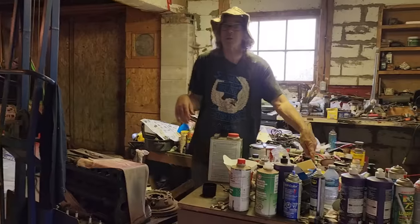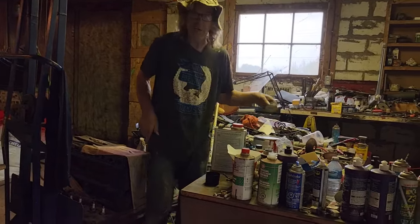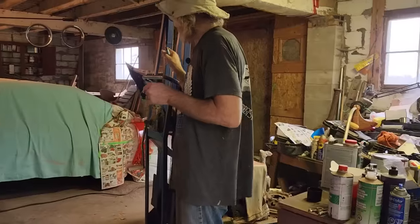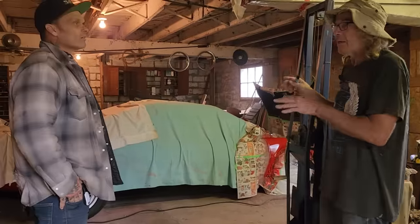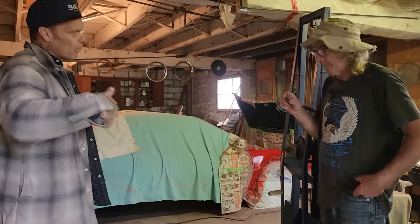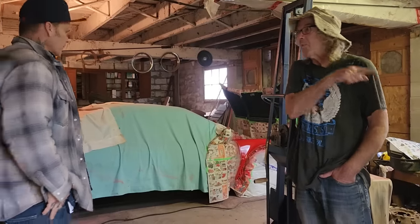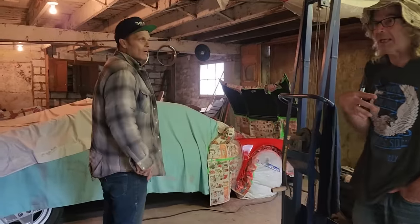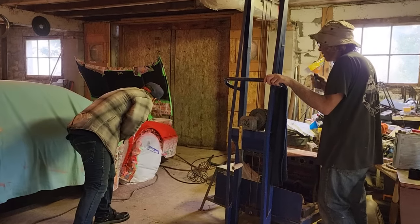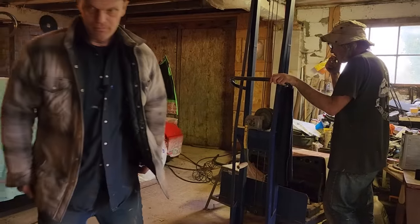That little screen was covered with oil when I put that top on, so that could have been our reason. So if it can probably handle a little bit of that, I would go a dry coat over it all, let it set, and then try to go a little more as you get going. Especially if I've eliminated the problem now with the new paint coming on, because if I was getting fish eyes consistently on more sprays, no matter what we do, we're not going to fix it. Try to get your edge coming down here, on this going that way and on that fender on the other side too, because you got both fenders, right?